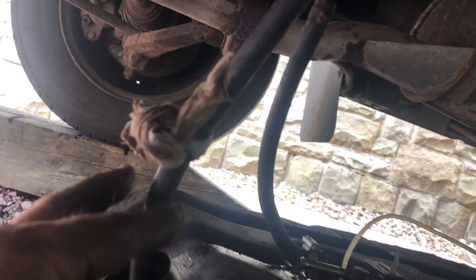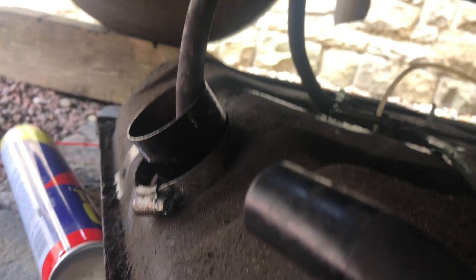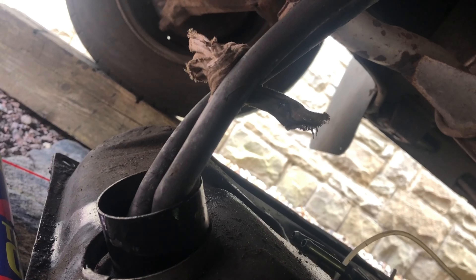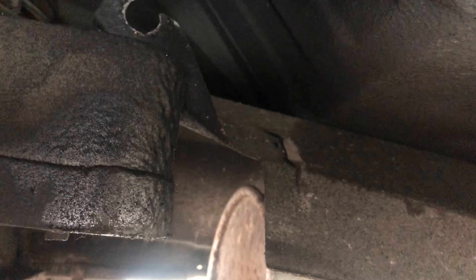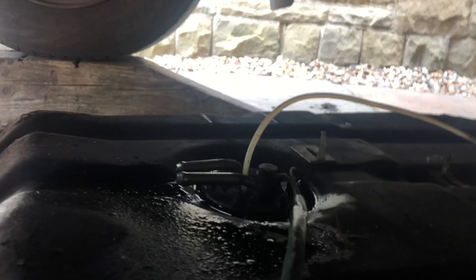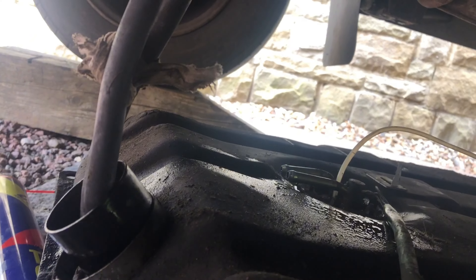When you remove these hoses you're going to get some diesel spills — I'm just putting it back into the tank. Take great care not to drop the clip into the tank. We'll let those drain for a minute. You can see there are traces of leaking diesel from the sender unit area. I've discovered something — we're actually going to have to reprime the diesel, so I'm going to show you how to do that at the end of the video.